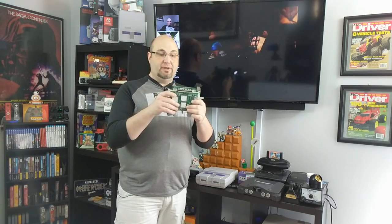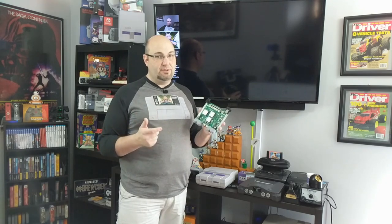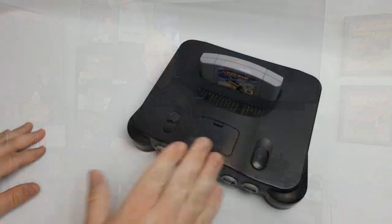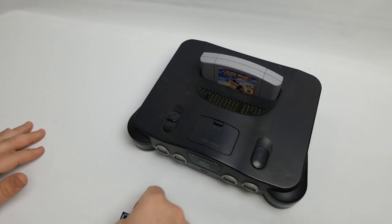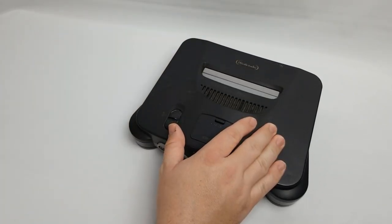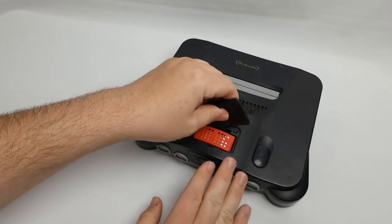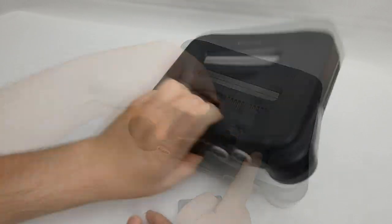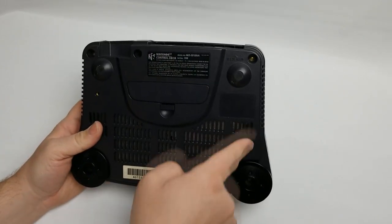We're going to take the machine apart. I have a secondary unit here, and this is what it will look like once you get it freed from the plastic casing with the heat sink removed. Make sure you put the heat sink back on before testing — if you don't, your system may overheat and damage the CPU, GPU, or both. Flipping the system over, we need to remove the security screws underneath. The serial number on your unit is extremely important — if you do not have an NS1 serial number, the odds of this working are slim.